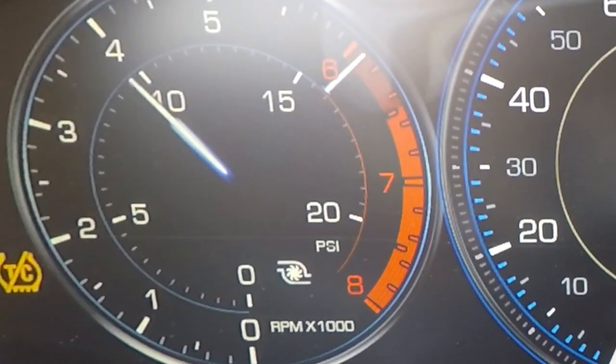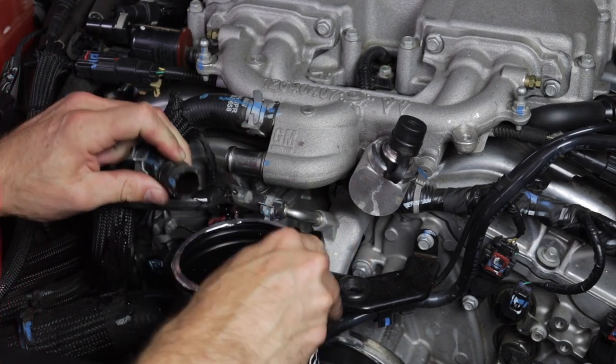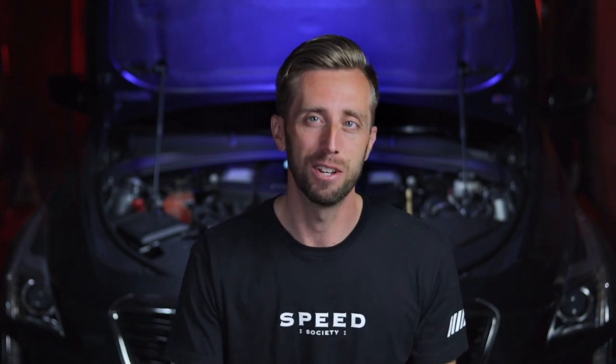One of the best ways to make sure your engine is getting the most horsepower possible is to ensure it's breathing cool air. Those turbochargers put out some really hot air, and we have a water-to-air intercooling system to help bring those temperatures down to something more digestible for the engine. But if it's not working like it should, the engine is ingesting hot air — it will reduce timing, may reduce boost or throttle even when your foot is pinned to the floor, and that's going to rob you of precious horsepower. Some ATSV owners have found their systems are not filled properly from the factory. A couple people said they were pretty much empty, and that's scary because without intercooling, the car has a high risk for engine damage.